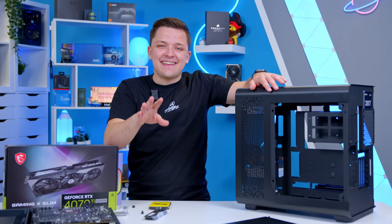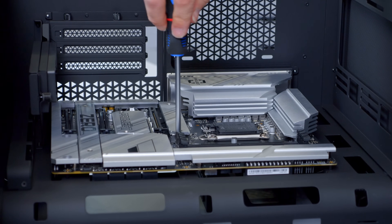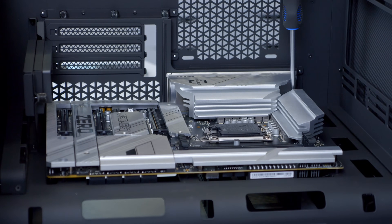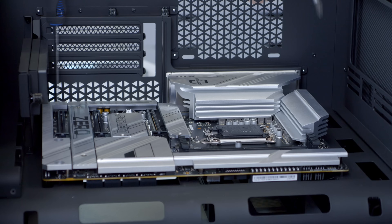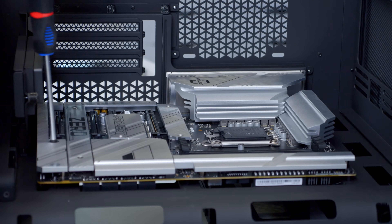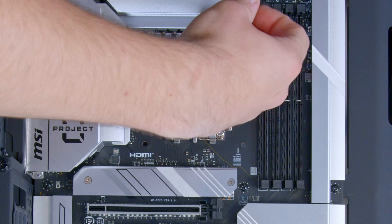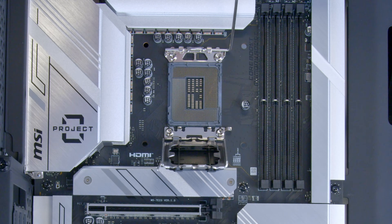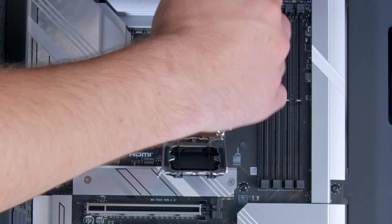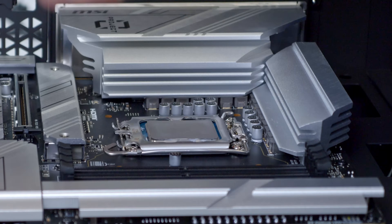I'm going to kick things off by putting the motherboard into the case first, because installing things like the SSD and CPU now are so much harder with those back-to-front cables — we can't just plonk the motherboard down on the table. The safest place for this board, with all its delicate pins, is in the case. Once the motherboard's in, CPU installation is a lot easier with no risk of damaging any cables. The CPU just pops into the LGA socket, the cover goes down, the retention arm goes into place, and we're good to go.